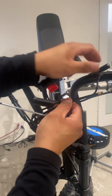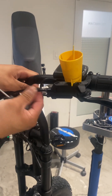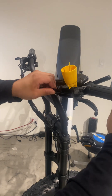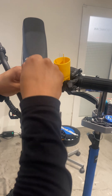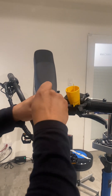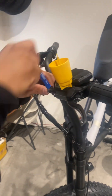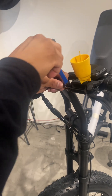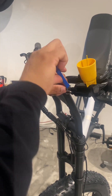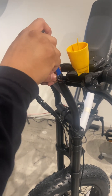From there, all you need to do is push it back into the brake lever. Make sure it's straight. Use a number eight millimeter wrench. I would say stop when you feel it's a little bit tight — don't over-tighten because you'll strip the threads. Try little by little, and when you feel it's all the way in, just stop there.